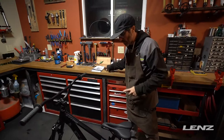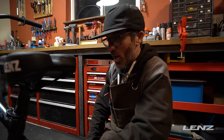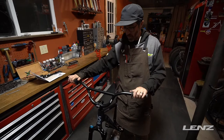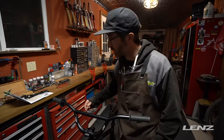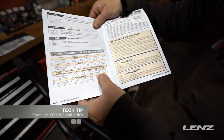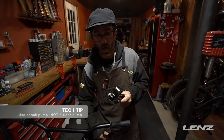We're just going to go over the rear shock real quick. We got a little red dial — it's going to be your rebound adjustment. Rebound adjustment is going to control how fast the shock recoils after it's compressed. Now we're on to the fork — just a real quick run through. We got an air spring, a compression adjustment, and rebound adjustment at the bottom. In the owner's manual on page 7 there is an air chart guide — you're going to go to the stitch model, it is the bottom bar here, and it is going to give your rider weight. You're going to have to convert it from kilograms to pounds. Depending on your range, the lower one is going to give you the range of air pressure. You do need to use a shock pump — you cannot use a traditional bicycle floor pump to put air into your fork. These pumps are available at any bike shop.